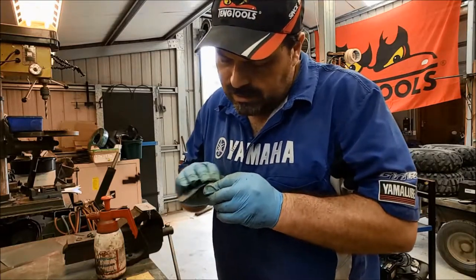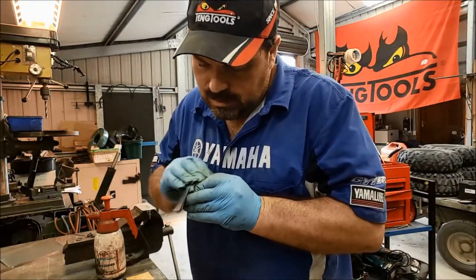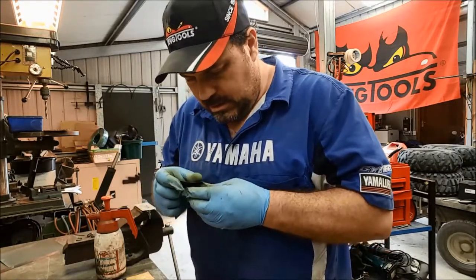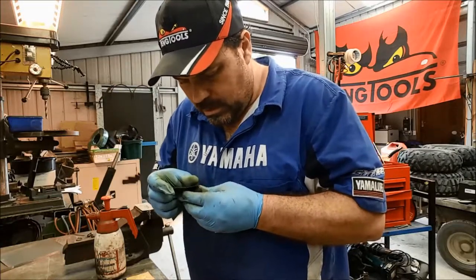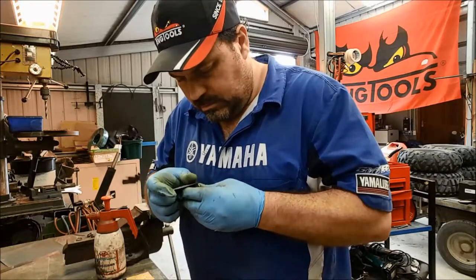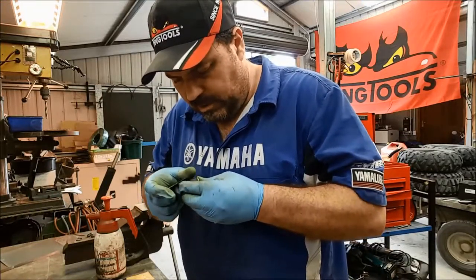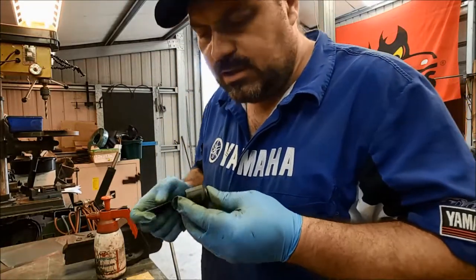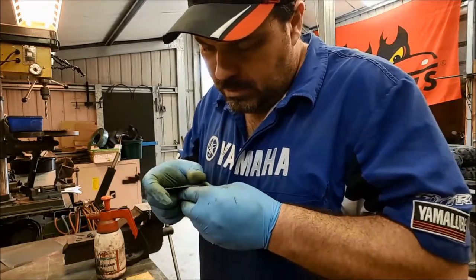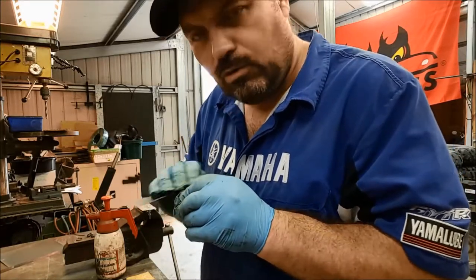Okay, so I'm just really lightly sanding the surface of these pistons to try and get them nice and smooth, really. I tried cleaning them and it just won't come off. So just give them a very gentle run over. I'm not really a fan of plastic pistons. Now notice that I'm not sanding them in this direction. I'm actually sanding them around the piston. That is going to help to prevent any kind of leakage. Just don't forget, when you sand something, you leave little tiny grooves in it.